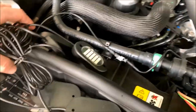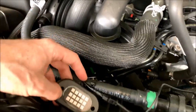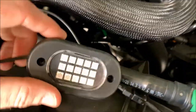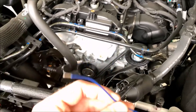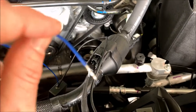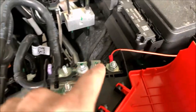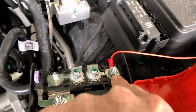Just finished testing all of the lights out — they all work. The remote works, and I'm sure the app will work too. These lights are actually pretty bright; I'm surprised in the daylight. You can tell one of them is not as bright, but the ones back in the engine bay were much brighter. With the brake light wire, when I tapped it on there it just made it solid, so I'm pretty sure that's what it'll do when I actually hook it up. I don't think she's going to want the rock lights working off the brake lights, so I'm not going to connect that wire. For my power and ground, I ended up using this little existing bolt right here — nothing was already attached, so it worked out perfectly.